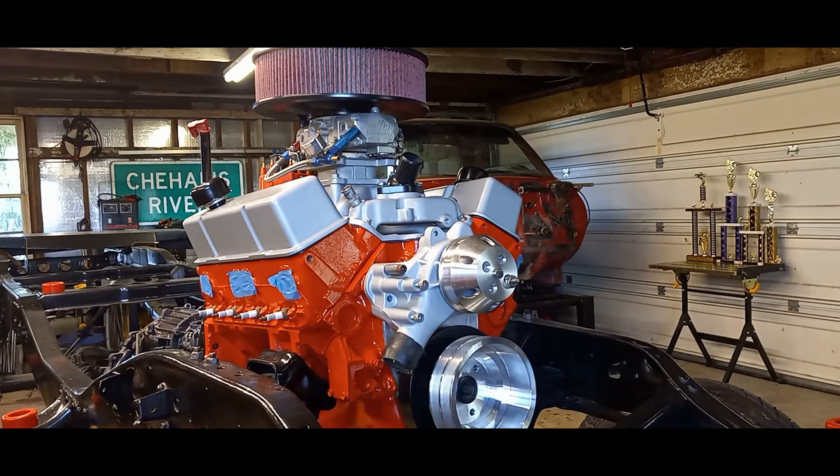Back to the point — even with those heads having 60-plus hours of just grinding alone, plus flow bench testing, I'm still leaving horsepower on the table with these. These heads are definitely maxed out on their ability to support higher horsepower. A set of good aftermarket aluminum heads would better suit this engine. Something like this needs a head around 220cc intake runners, preferably ported for the cubic inches, horsepower, and RPM requirements of a 383 making peak power around 6500 RPMs, needing to rev about a thousand RPMs above peak power without the horsepower completely falling off dramatically. This head would be much more comfortable supporting around 450 to 500 horsepower, preferably on a 355. You could actually achieve better results with ported Vortec heads versus these 186s.